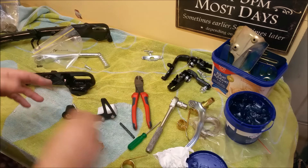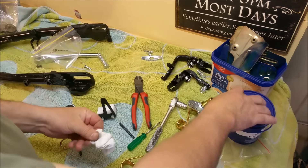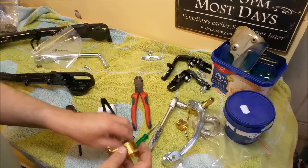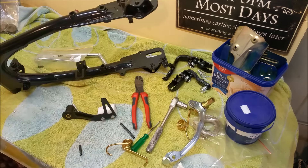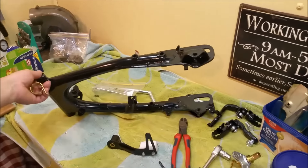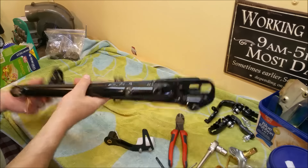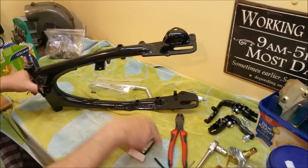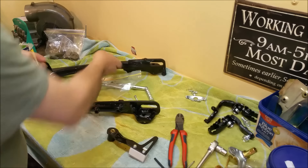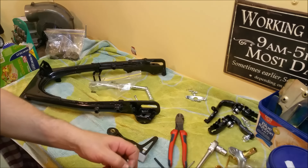Stick that in there and that's good to go. I'll just wipe my fingers. Now the other thing I wanted to mention was the spring for the tensioner, which had a way of lying against the frame. The tensioner sits in here like that, and of course there's a spring that runs up against the plastic powder coating. And I want to avoid that getting damaged, so I'm just going to slip some heat shrink over it, get a cigarette lighter and just arc it up.